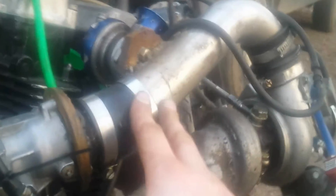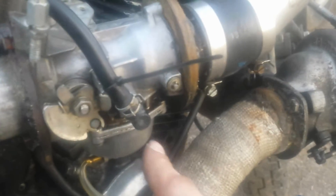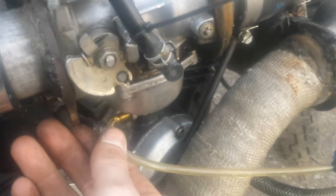It works pretty well — for every psi you gain in your intake tube, you have to pressurize your carb. Usually you drill a hole here and put a fitting above the fuel line to pressurize the fuel bowl from the turbo. But I'm using the overflow port because on this particular carb the overflow actually comes out above where I need it, so that worked out. Normally you'd cap this and drill your own hole.